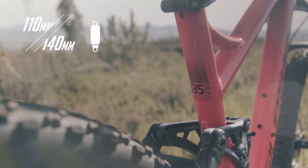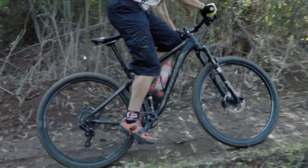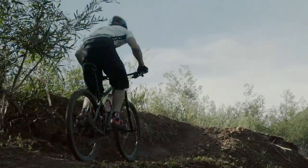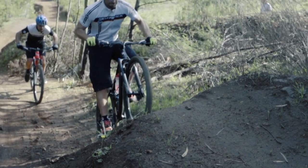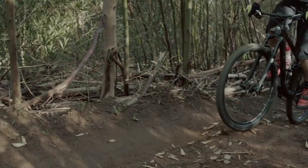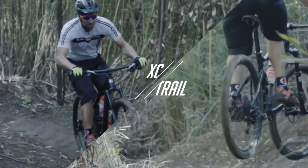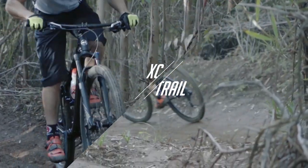These models fall into the trail category, which typically utilises between 110mm and 140mm of suspension travel. Many brands on the market currently offer very aggressive trail bikes with slacker angles and very heavy-duty builds. We have opted to create something that is better suited for all-round riding, utilising relaxed geometry coupled with efficient pedalling characteristics and robust hydroform tubing. We believe these bike models fit into an all-round category, or as we like to call it, XC Trail — a bike you can enjoy in a marathon race and also use at your local enduro trail.